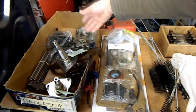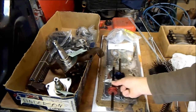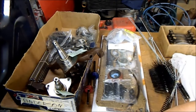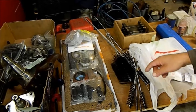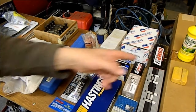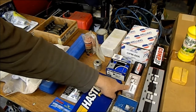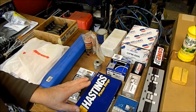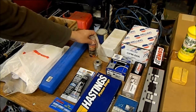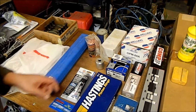There are some rockers, head bolts, and pushrods in there - maybe get new ones, maybe not, we'll see. We've got two oil pump drives here, both for Windsor - one's 351, one's 302. The 302 one's a bit shorter, but hopefully they'll fit our Cleveland. And of course our full engine gasket set. Over here we have our bore brushes and gallery brushes. We've got a bar of salt-free laundry soap to wash the bores down with. Our lovely Competitions cam with matching lifters - it's important to get them as a matching set. Main and big end bearings, Hastings rings, a bit of ultra black, some assembly lube and cam and lifter installation lube, a good GM sealer, our camshaft installing tool, and a special socket to turn the crankshaft over when we get it in. Torque wrench. And of course we have our main bearing caps over there.